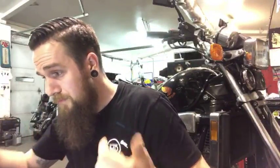Now there's usually three things that can go wrong. The pair check valve, this going bad. That one does not have one on that model. Or, like I said, you have some kind of rich issue. And his rich issue was they have a plunger style, so like an enrichener valve for the choke.